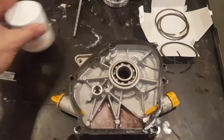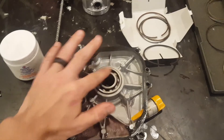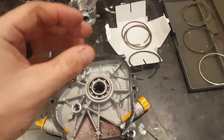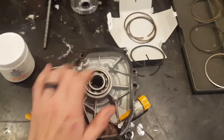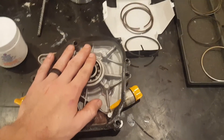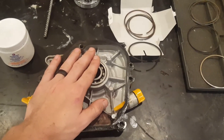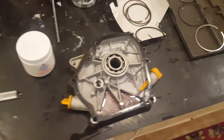The second thing I did was take a valve lapping compound — a very small amount, one pea-sized drop here and a pea-sized drop here — and I just moved it around inside the bearing. I slid the crank in, put the nut on the end of the crank, hooked a drill to it, and spun it really fast to make the bearing wear in. I did that for about 30 to 45 seconds and it really freed the bearing up a whole lot. It wasn't bad to begin with, just somewhat tight. I'm trying to reduce as much frictional drag as possible. If you want longevity out of your engine, leave it stock — but if you want power, quickness, and low internal drag, that's what I'm after here.